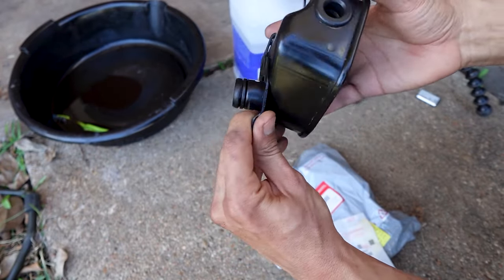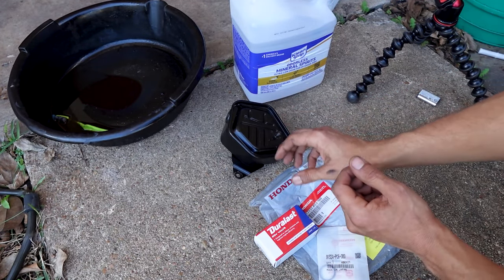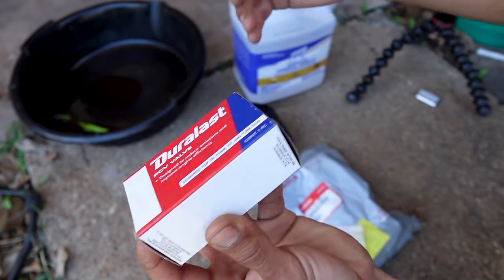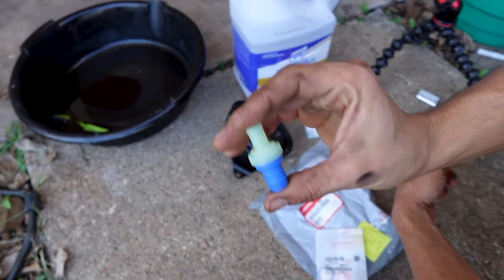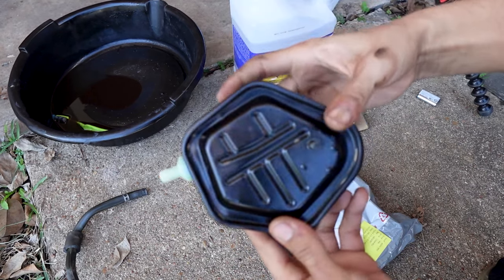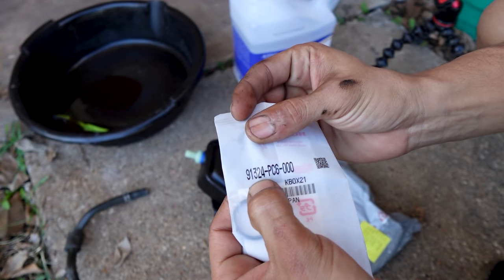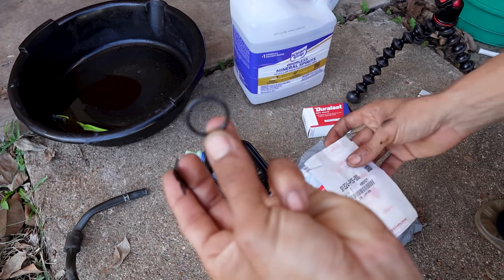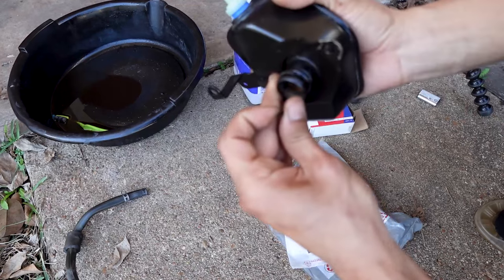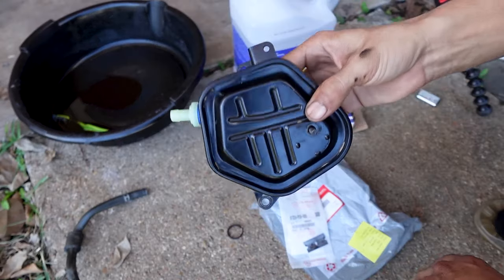This is all scrubbed down. I still have the old o-ring here but I have some new Honda parts. The PCV valve from AutoZone — part number PCV1192DL — was about four bucks. Give it a shake, that's how it should sound. I'll get this pressed into the PCV box and that is good to go. Next is the o-ring that goes into the block — part number 91324-PC6-000. I'll take off the old one and put the new one right on.